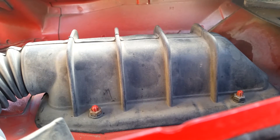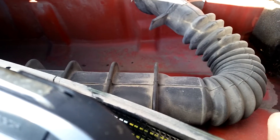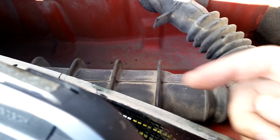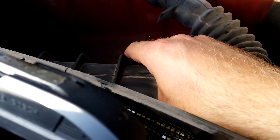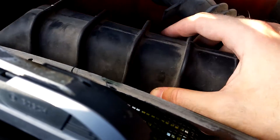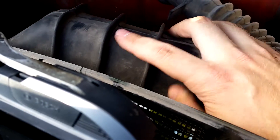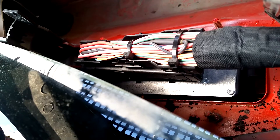Be sure to have the upper part free from the windshield so you don't put too much stress on the plastic. Down here we will be able to see the ECU. This is what you find under the cowl — here's a rubber boot protecting the ECU connector, and there are four 10mm bolts. Those we'll remove now.